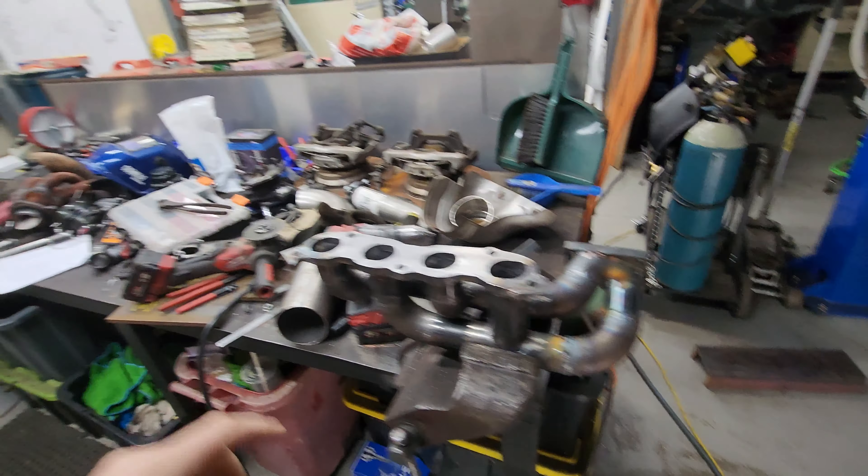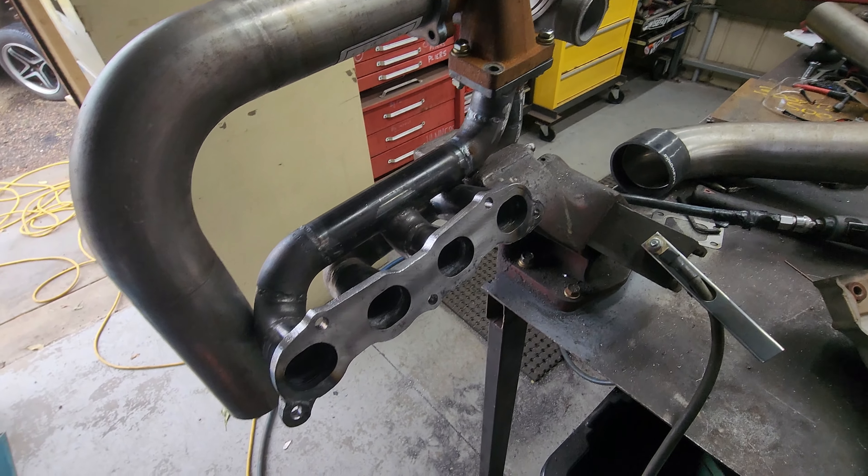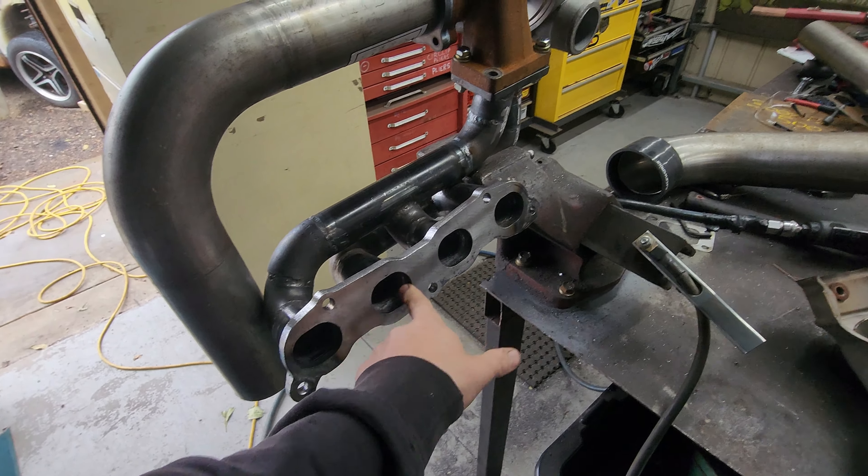New morning, the bench is full of things again. It's time to trim bolt holes and then I can clean up all of the insides and outsides of these pipes. I want to make sure like five times over these are in the correct spots because I don't want to deal with that again, but I think we're pretty good because everything lined up. We've got everything back together - I've gone through and cleaned up the edges of the flange, I've ground around the bolt holes so they're nice and smooth. Now I need to get the flange faced and then they'll be nice and flat.